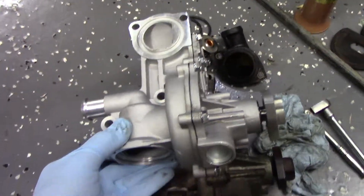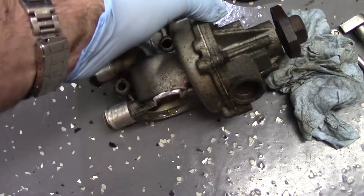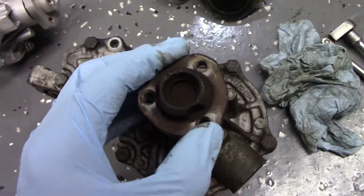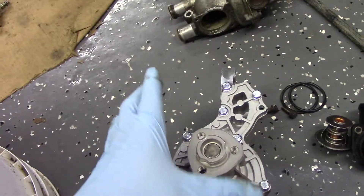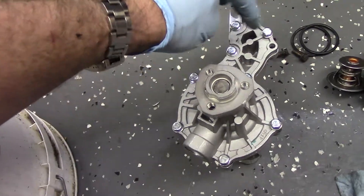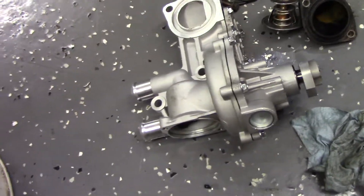So we have the new water pump and it looks to be correct. You can see where I screwed up and ran the bolt up in there and blew that piece of the water pump housing out. The old one was actually a true VW water pump, so it could possibly be original. Here's the new one — aftermarket, piece not blown out. Typically you have to pull the timing cover and timing belt to change the water pump, and a lot of times bolts will break off, but usually once the housing is off you can back them out with vice grips. Typically you don't break the housing, but anyway — this whole setup with the housing and water pump was about $34, so I don't feel too bad.